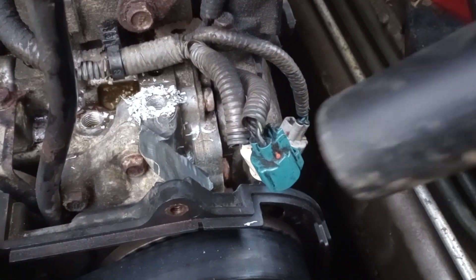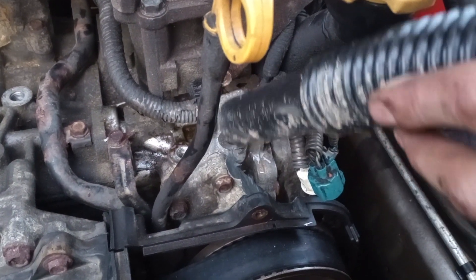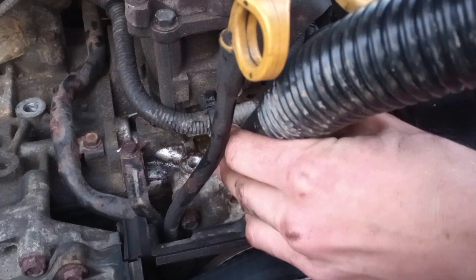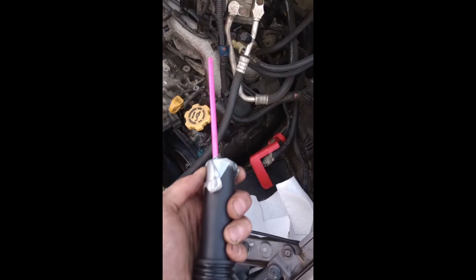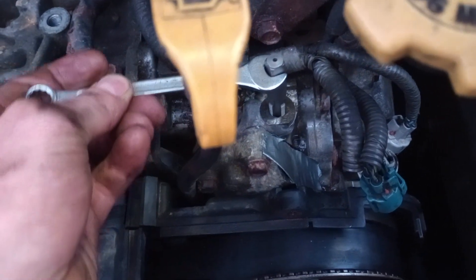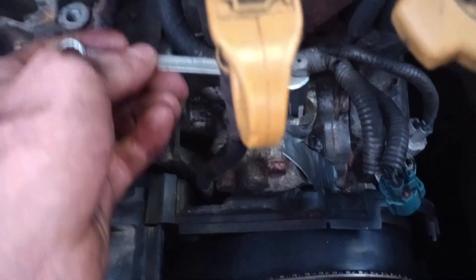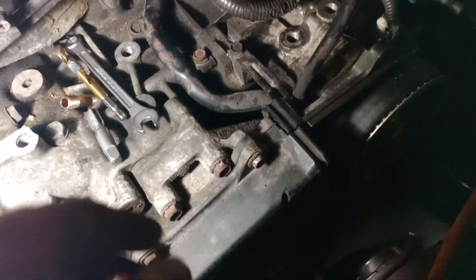As you can see, our drilling made quite a mess, so we've got a little shop vac here and we're just going to try to suck up as much as we can. I put a straw with some duct tape on the end of the shop vac and it seems to get a lot of stuff out. Here we've got the tap going in, going slowly back and forth until it gets nice and easy — we'll run it all the way down until it gets stuck. We ran the tap all the way down to the bottom.